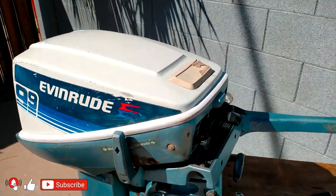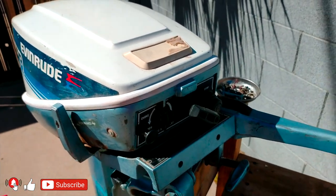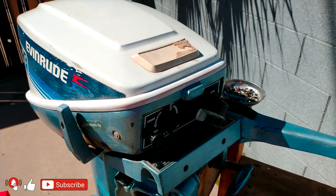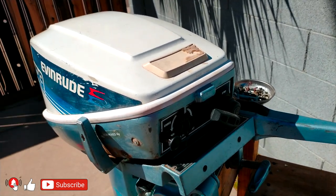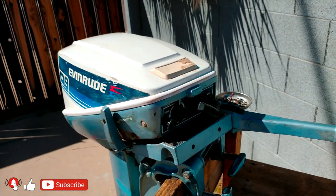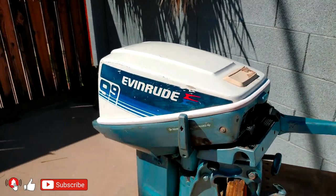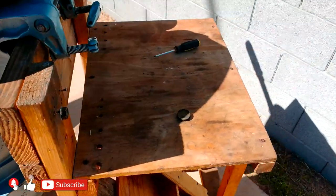What can happen to this motor when you have the cup removed? On a rainy day, some water can get inside. Maybe not much, but in some cases you may have misfiring. Some water can go inside, especially if the motor is laying down — water can get into the carburetor and the engine, and then you can have other problems. The first thing you can do: you already know — you can remove this cup.